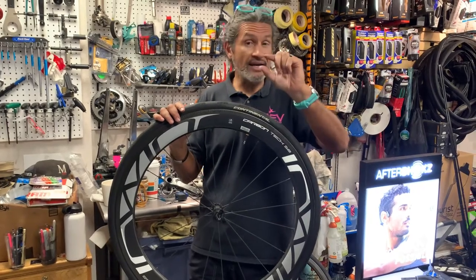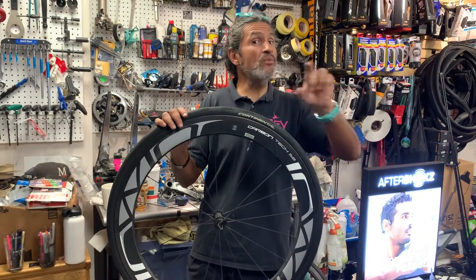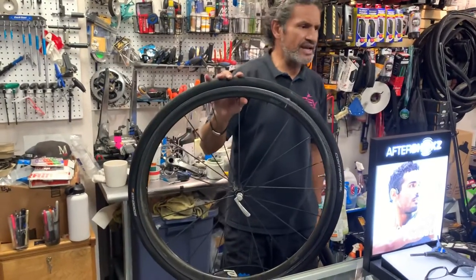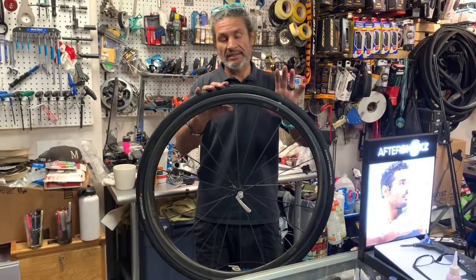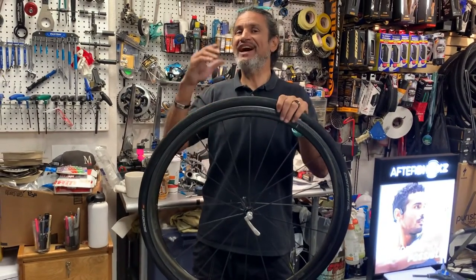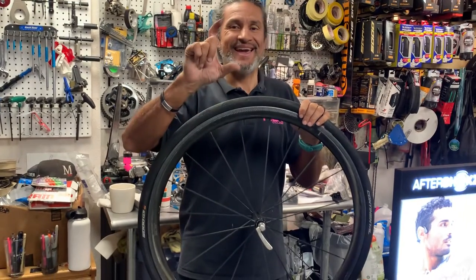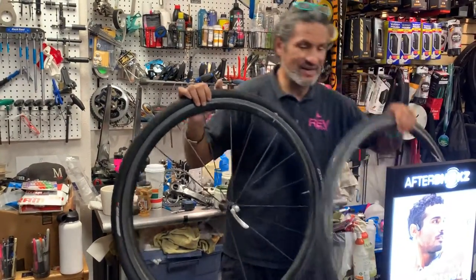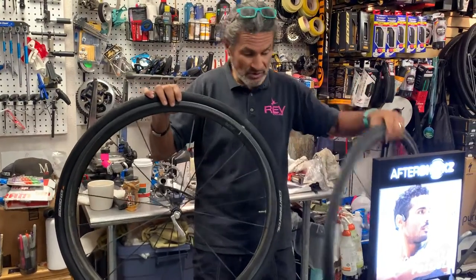On my own personal level, I like a shallower rim — a lot more manageable in any wind condition. I like probably no more than about a 40 millimeter wheel. This one was about 35, and I've got another one that's 38. There's also a benefit that you probably never really thought of: it's much more common, if you've gotten a flat on the side of the road, that you'll find someone who has a tube with a long enough valve for a shallow wheel. A 48 millimeter valve stem will fit, and that's typically the most common tube sold in most bike shops.